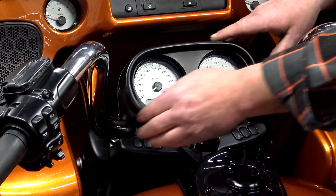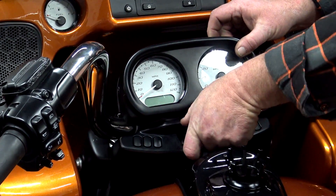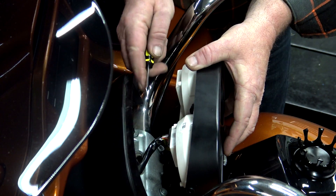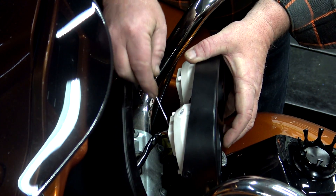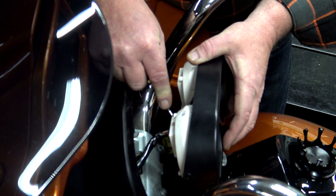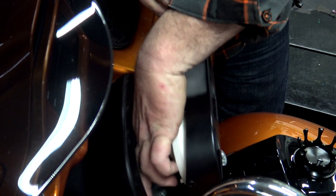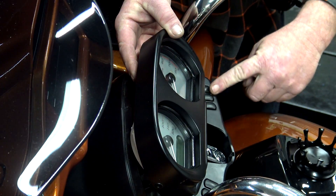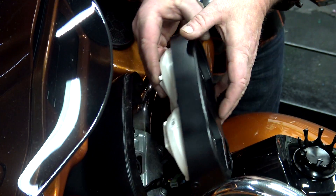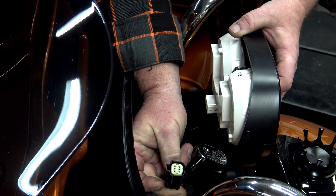Once you get those two screws removed, this will lift up from the back of the bezel housing. You can kick your ignition over, pull this up, and it'll go around it. On the back side of your gauge cluster there's a little clip on the wire harness — a clip on this side and a clip on this side. I don't have fingernails so I just use that same little pick to get it off. Then you have the switches on the bottom — mine are false but there are still plugs on the back of them. Just unplug them.